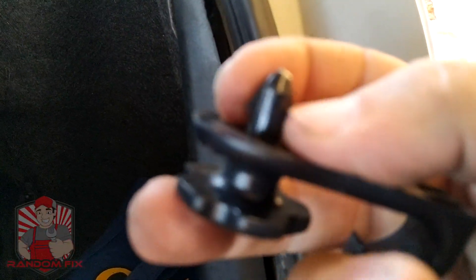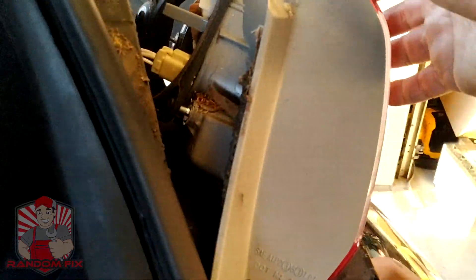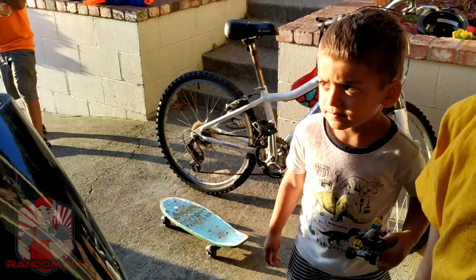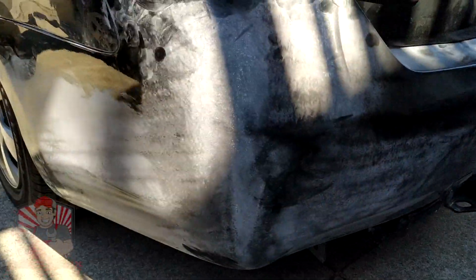Remove this cover and you've got another 10mm bolt right there, and now your light is somewhat loose. Sometimes there are little retaining clips like this and you just need to use one of these pointy screwdrivers — that allows you to just pop it out. With all this popped out, I'm going to remove my rear bumper. We've got the kids here helping, and to make it easier just go ahead and remove the brake light completely. With that out, the bumper is pretty much out — super easy.